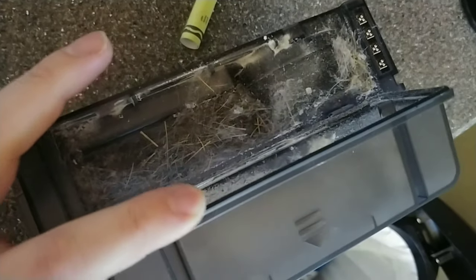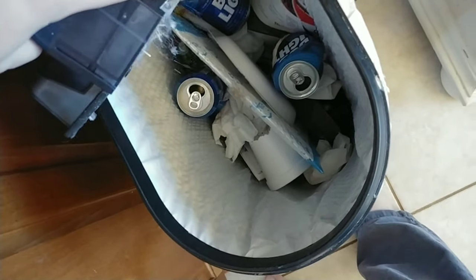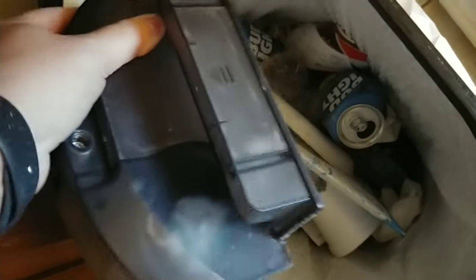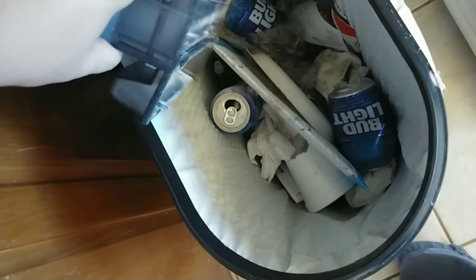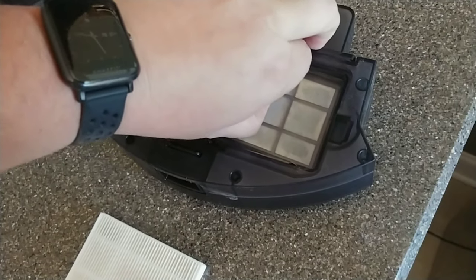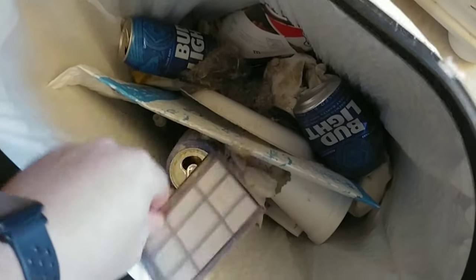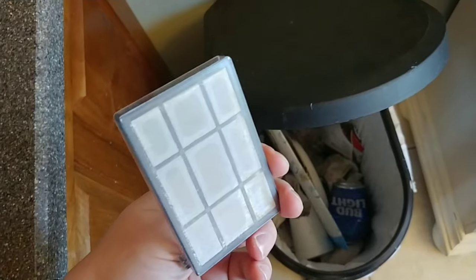Here's the trash bin after this run. It had some powder and stuff in there, which it didn't need to suck all up - it was just to try to find out where it was missing on its passes. I knew it wouldn't be able to get it all because that's difficult to suck up even with a powered vacuum. They got pretty much a full load out of this thing. Sometimes you have to reach your fingers in to get something if it's just hair - sometimes it's hard to kick out. But most of the time it'll clump up and fall out. I was surprised that the filter did not really get dirty - the pre-filter, which is made to catch larger particles, caught the majority of everything. That will prolong the life of your little paper filter.